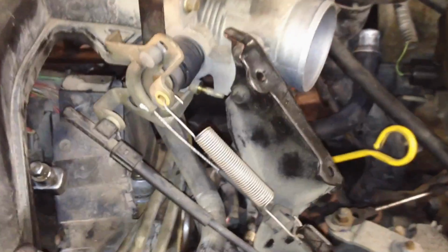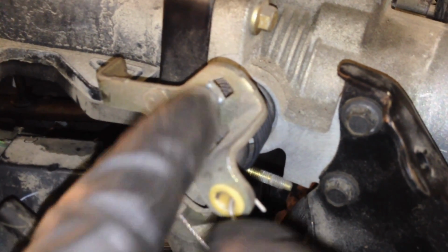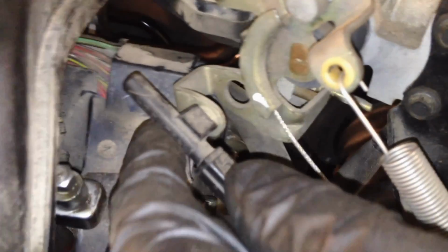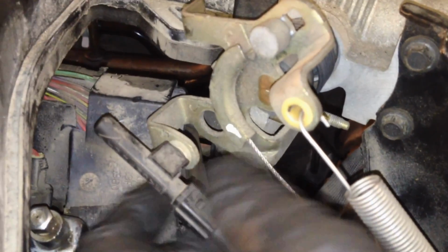Then we're going to get our throttle cables back on here, our 2 bolts, and then we're going to hook in the throttle return spring. It faces this way, J hooks that way, and this just wraps around and then it hooks into the slot right there. Just match it to the slot, push it through, and it'll turn and it'll be perpendicular to the slot. And this one, you just go up and around it, and then you pull back and it'll clip in, you'll hear it.